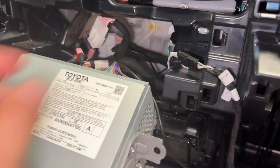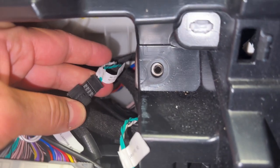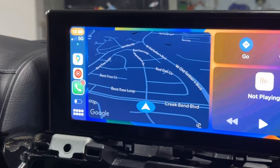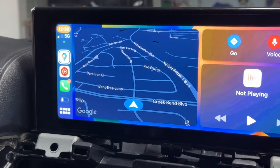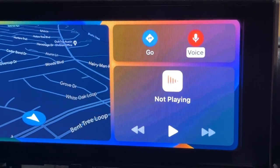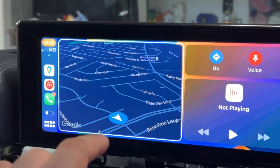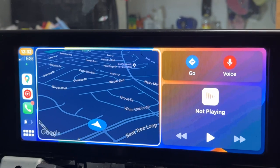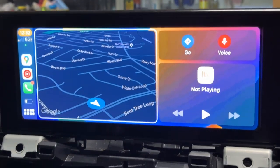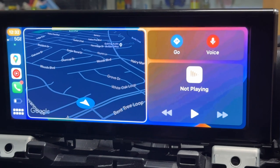Behind this guy — remember I took the touchpad cable interrupt, plugged it into this. The other end that I disconnected, I had to connect this little loopback cable to it. Now when I use the joystick, it actually works. You can see the cursor is right there. Whenever I'm filming, the joystick doesn't respond and keeps getting jittery — but as soon as I stop filming, it works. That's why it was working earlier when I plugged in the loopback cable and came back. I just can't show you while I'm filming, but it does work, and the menu and back button also switch between views and the app drawer. So it's functioning now — my sound is working.